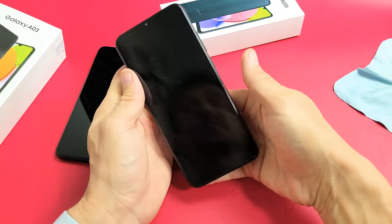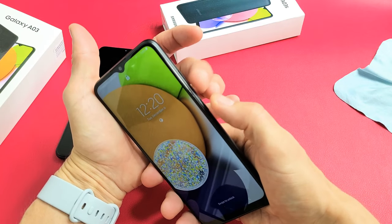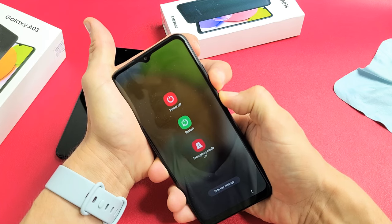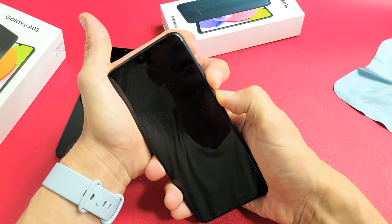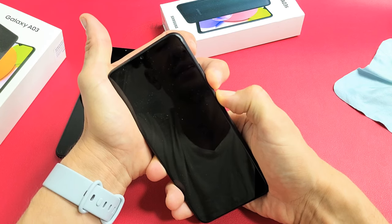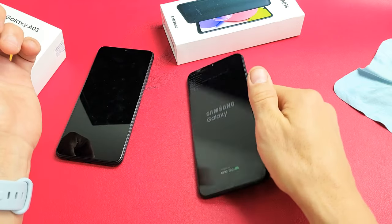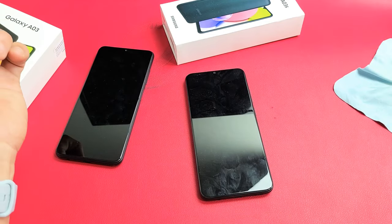Press all over the back, around the camera lens too. Your screen may turn on, be totally black, show half a screen, or show white lines. Then tap your power button to see if your screen is on. If not, do the force restart: volume down plus power, press and hold until you see the Samsung logo. It just turned off — wait for it to turn back on. Samsung logo, there it is — let go and hopefully your screen is on.